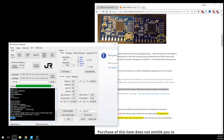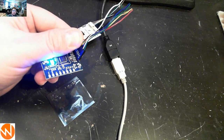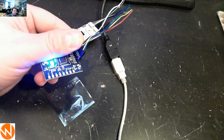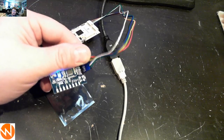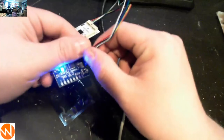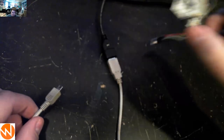We get a success message from JRunner, the blue light on the chip lights up, there's a little blinking, and ultimately we get a success message. Our glitch chip is now successfully programmed. To recap: we used the JR Programmer to read the NAND, write the ECC file, and program the glitch chip. Now we need to physically install the glitch chip.